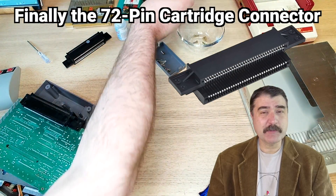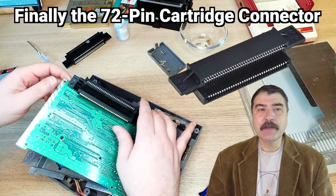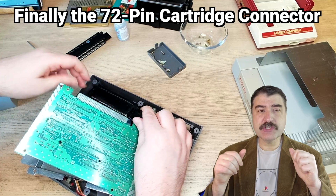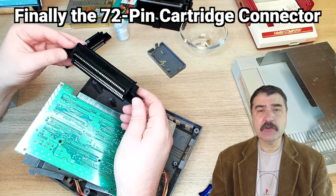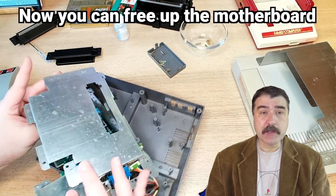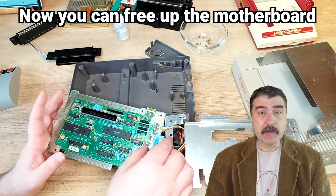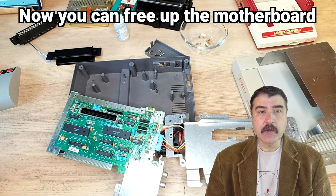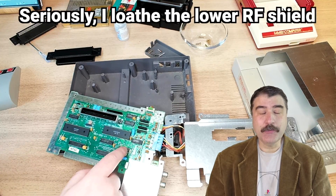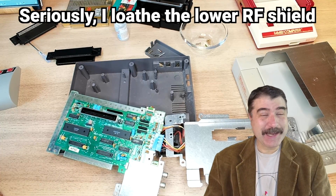Then you are going to be able to see the bad boy that has been causing all of the problems: the long U-shaped 72-pin connector. The 72-pin connector is on there pretty tight but it can just be slid off by applying equal gentle pressure on both sides, making sure you are not bending the board as you push it back — it should snap off. If you want, you can remove the remaining screws that keep the motherboard attached to the lower part. The front power buttons, ribbon cables, and controller connectors were entangled underneath the lower shield — I greatly enjoyed removing it and throwing it away. Stick it to the FCC of the 1980s. I did it and you can too.